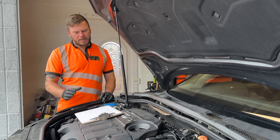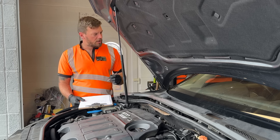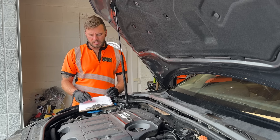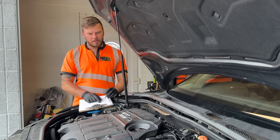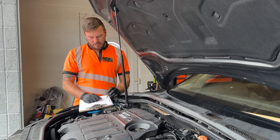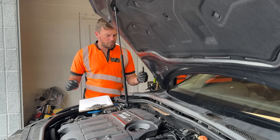Just been over the car now - it's not as bad as I thought, to be fair. I thought it was going to be a hell of a lot worse. The driver's window is not working, so I need to have a look into that and see whether it's the motor or mechanism - strip the door down and go over that one. We've got the front trim that just needs refitting around the grille. We've got the offside rear brake light bulb out, so good job I checked them. The nearside front tyre has got a bulge in it, so I'm going to have to get that replaced - and it's flat anyway. The top mounts sound quite noisy, so I'm going to try and spray them up because it's been stood a while and there's probably a bit of rust in there.